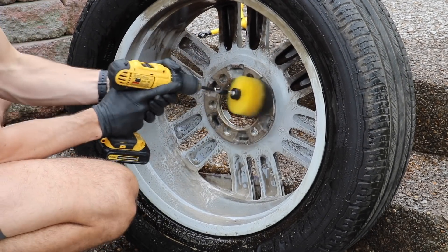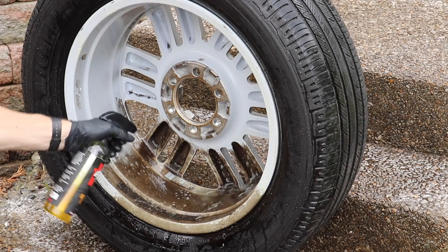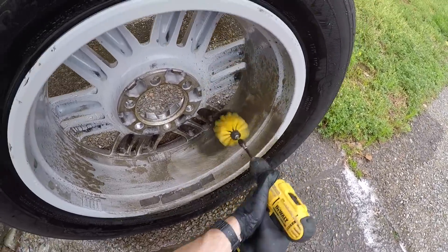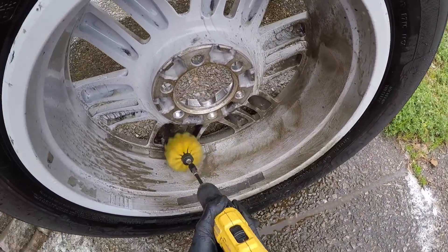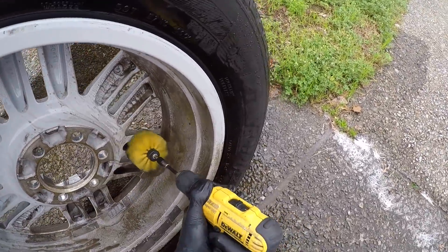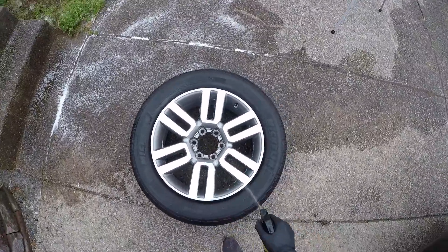The interior part — the inner barrel of the wheel — is not actually the exact same material as the face of the wheel, where we use softer detailing brushes because the clear coat is very easily scratched. It's not the exact same clear coat, not the same structure. Like if you think of the exterior of paint, you have the body, primer, color coat, clear coat — it's not exactly like that on the inner barrel. So it actually is an appropriate moment to use a drill brush that is a bit stiffer. And the brake dust on this wheel is not going to come off in any other way, which is why I'm having to pull it out in the first place.